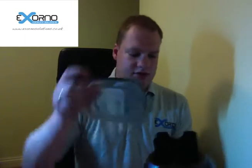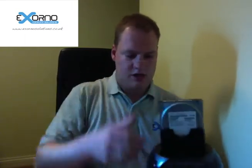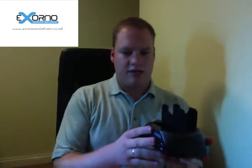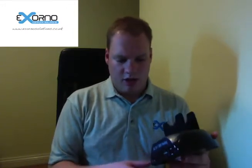It's very good. So as I showed before, just get the hard drive, drop it in, it spins up and it's ready to go, and it's hot swappable as well. Only thing I've found so far on some newer hard drives, when they're running in there for a long time, they do get quite hot. I've had a couple of drives that got so hot they turned themselves off, which I assume is a safety feature on the drive. Older IDE ones I've not had a problem with, just a few SATA ones.